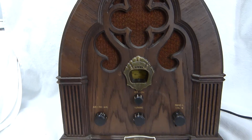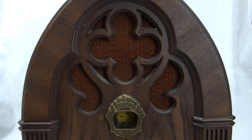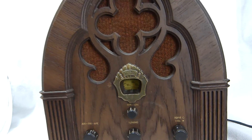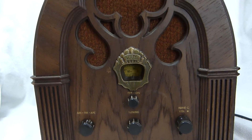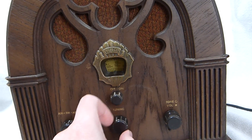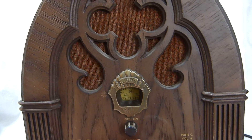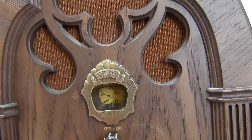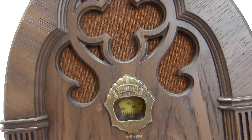The set is reasonably well made and performs fairly well. The only thing I've done to this set is repair the tuning mechanism. The tuner uses a friction drive — there's a little rubber wheel attached to the shaft that used to run across a foam strip on the inside of this dial drum. That foam disintegrated, so I replaced it with a piece of felt, and that works pretty well. You can see it moves smoothly.